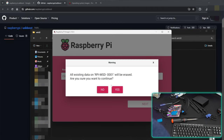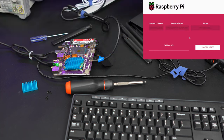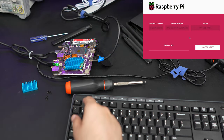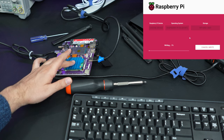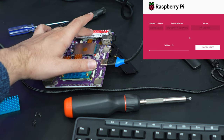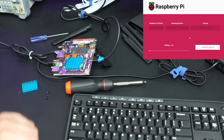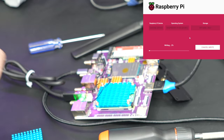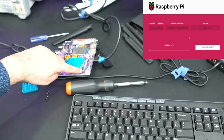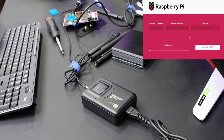After doing the customization you'll be prompted and you say yes, and it will start writing Raspberry Pi OS 64-bit into the CM4 eMMC. After that we'll be able to boot. Once done, I put the heatsink in - this is the 5G modem - and we'll later try to boot from the NVMe SSD. Remember: USB-A to USB-A, you don't need the power, and you need to put the jumper on. Let me finish this process - it's going to take a while.